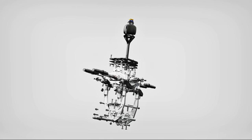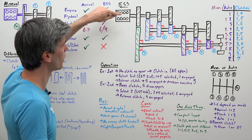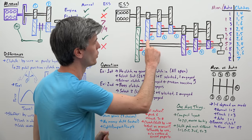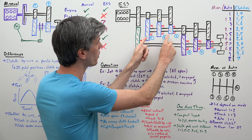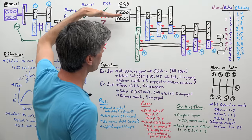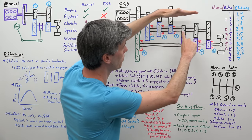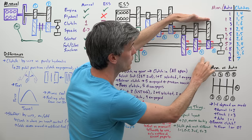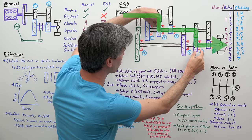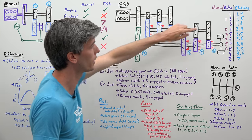So how does Koenigsegg's transmission actually work? Power from the engine needs to make its way to the driven wheels. First it has to choose between three gears — each gear in blue is on a bearing, connected to a clutch that connects it to the shaft. As power comes in, one of three clutches engages, sending power to one of three gears, each with their own individual clutch. You choose one clutch on each side, connecting a pathway for torque to reach the driven wheels. Three times three gives you nine forward speeds.